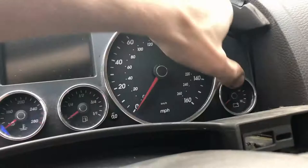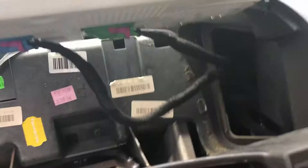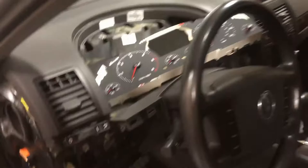From the driver side, you can kind of just shove it past the inside hole — it comes up sideways a little bit. Get it up to this point, and then you'll need both hands: push down on the locking tab and then lift this purple connector piece up. It's not too hard but it is hard with one hand, so I'll pause the video there. The issue with this one is the needles light up but the backlight for all the gauges doesn't work.